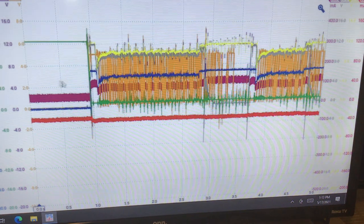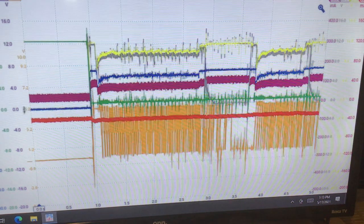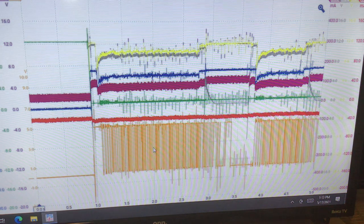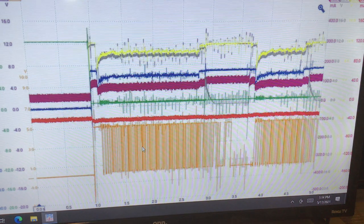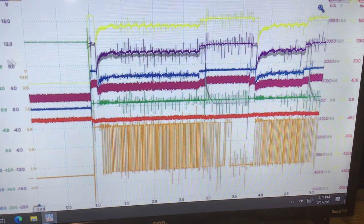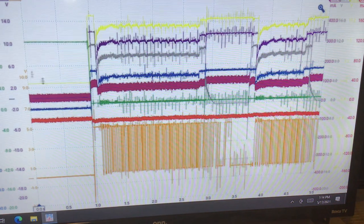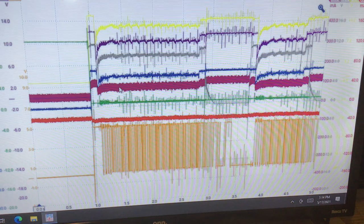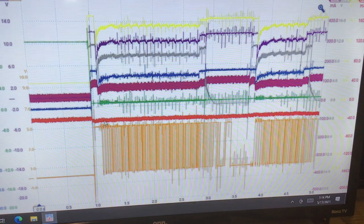We have things playing out differently here, and it makes a lot of sense when we break it down. We have a crank signal. You can see here, we have a crank signal because our PGI main relay is working properly. We have the PGI main relay closing and powering the PCM at yellow and purple. As we can see, we're strong at yellow and purple because that relay is latching. Our ignition feed is good. That's from the ignition switch on gray. You can see that on your schematic. That's pin E9. We have current flowing through our PGI main relay coil. We don't have any flowing through the ignition relay coil because our fuse 2 is removed.